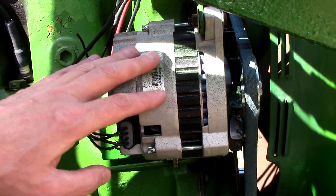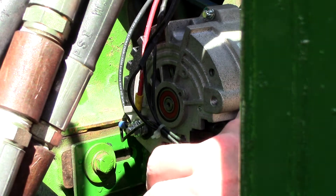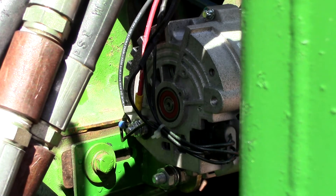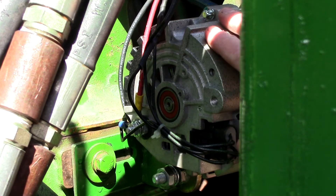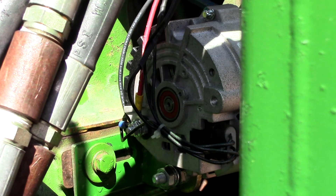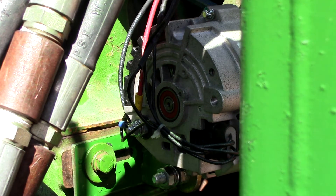For the wiring, off the back of the alternator is the main power output terminal. I ran a fresh piece of 10 gauge automotive wire from that terminal directly to the battery. The whole alternator body is grounded through the mounting bracket to the engine and frame, but just to be sure, I also ran another 10 gauge wire from the mounting bracket directly back to the battery. This alternator is good for 100 amps, so I wanted solid conductivity — a pair of 10 gauge wires going directly to the battery terminals.